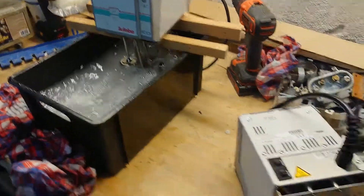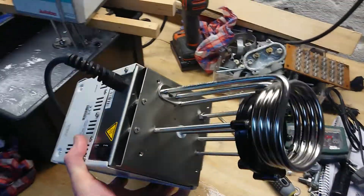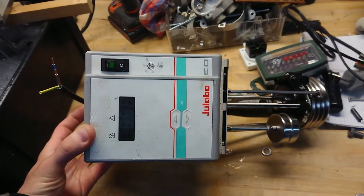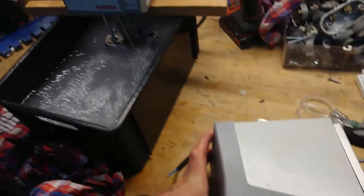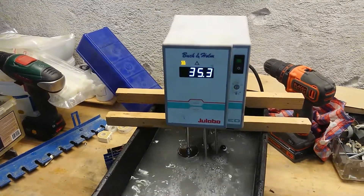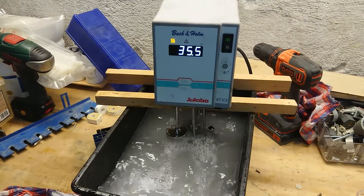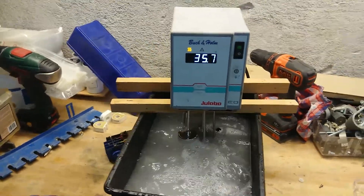Overall, two quite nice units — probably worth a good sum of money to someone. It's starting to blink on the heating element over here, so maybe it's switching over to a pulse width modulation, turning it on and off so as not to have such a steep heating curve and avoid a massive overshoot.